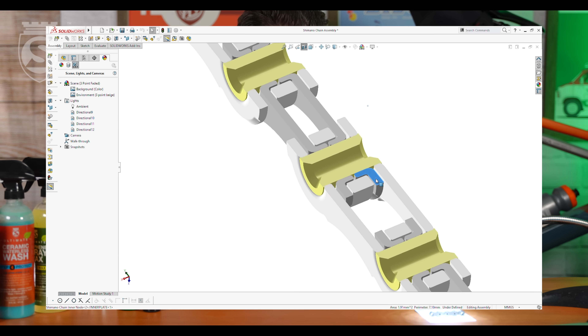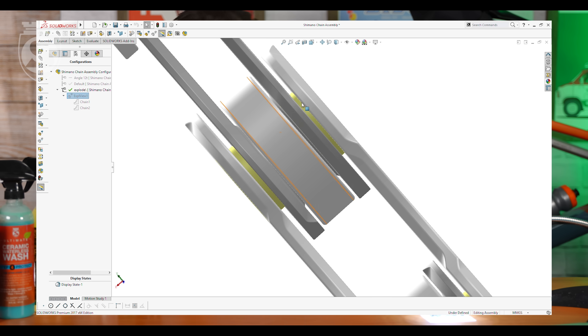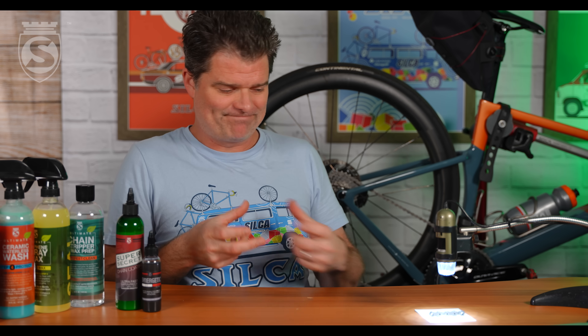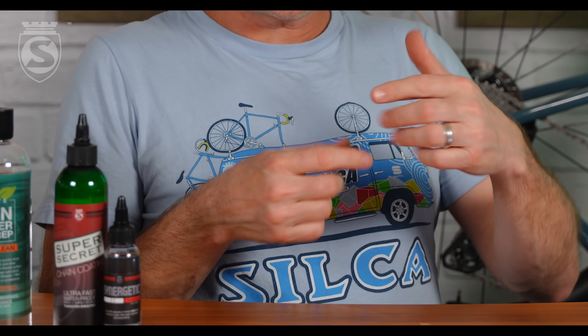It's almost like a pump between the side plates — you're opening and then closing the wedge between the side plates. More importantly, the inner plates, which are the actual journal surfaces that the chain pin rides on, articulate laterally and open up their own wedges between their inner surfaces and the pin itself. Here's a CAD image of what's happening inside the chain and what it theoretically looks like articulated. When it articulates those surfaces — which theoretically are line contact — those open up and become point contact, then close, then articulate in the other direction, opening that line contact to a point on the other side. You get this little wedge pumping action.